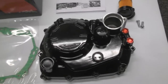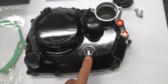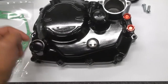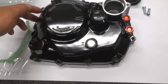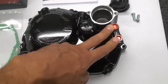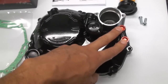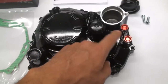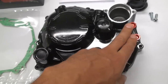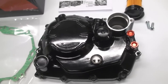This clutch cover has some really nice benefits. As you can see from the outside, it's got a sight glass like most motorcycles have these days, so no more dipstick. It's got external oil ports to run an oil cooler the proper way — this thing is specifically set up to run an oil cooler. So if you want to run one, whether you have a Finbro big bore kit or just stock trim and you want to cool the bike down, you can run oil ports to your oil cooler. Very nice bonus.